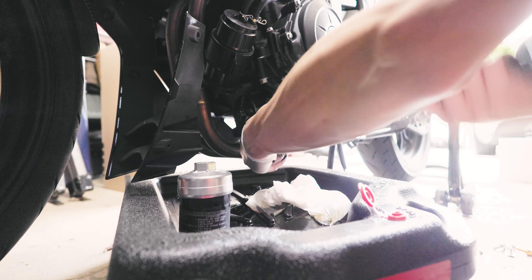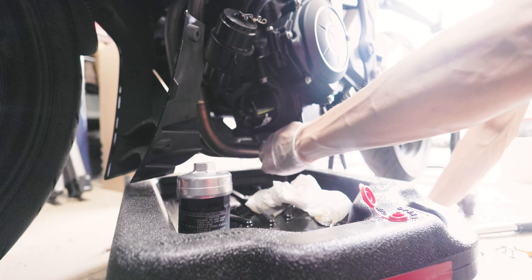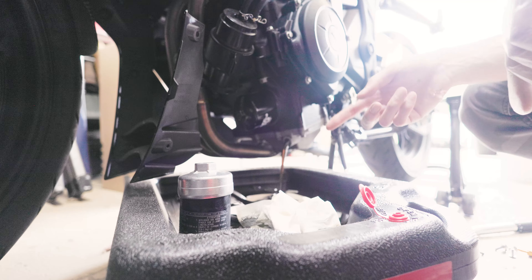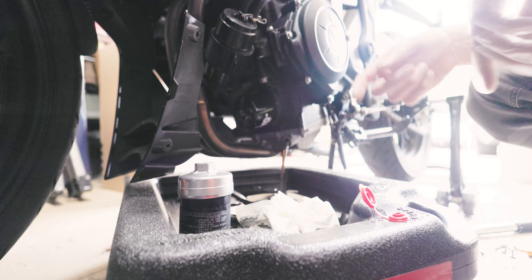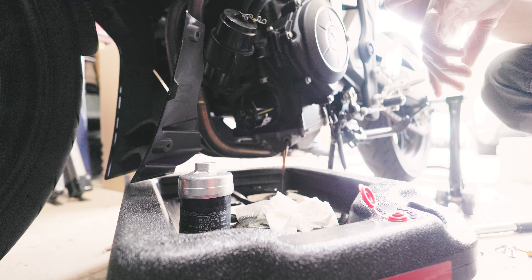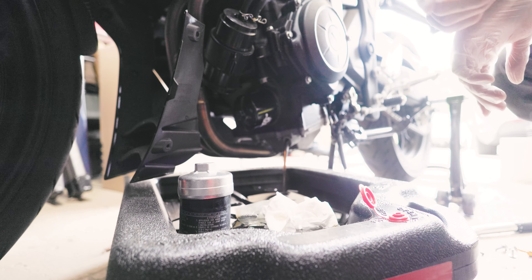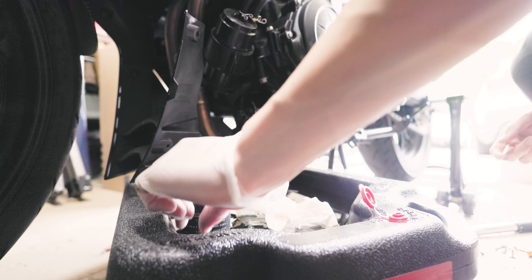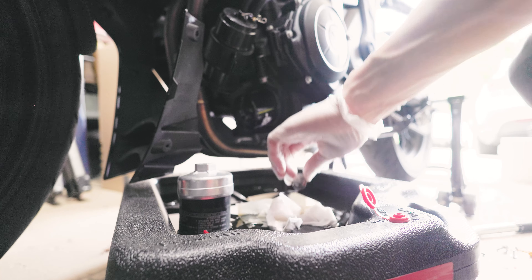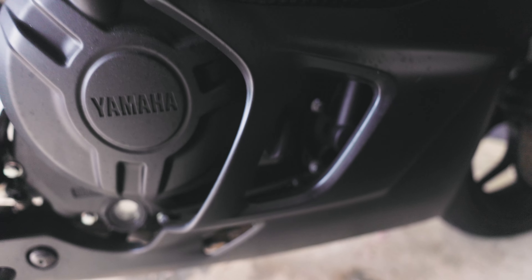Crack that open, then you can just loosen it by hand and oil should just start coming out — be careful. As you can see the oil is very dirty and dark. Let this oil drain completely until there's no more. Then take the drain plug — if you're using a new one, same deal — put it back in and torque it down to 20 Newton meters or 14 foot-pounds of torque. You could also lower that slightly to around 13 foot-pounds just to be safe.